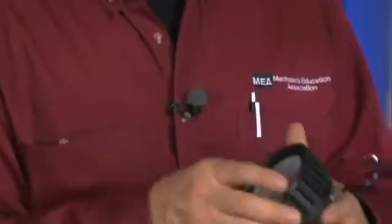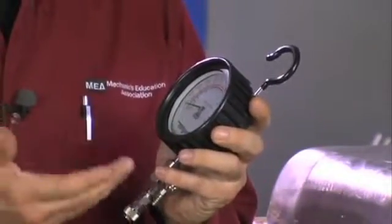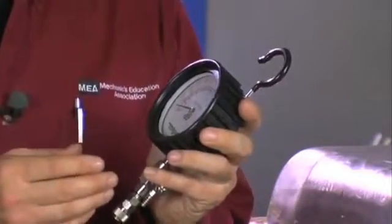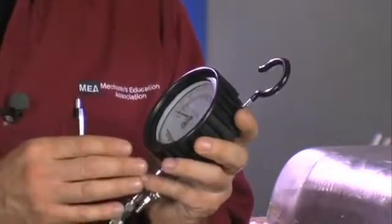We're going to need tools in order to check the pressure, to check the volume, and of course check the electrical integrity of the entire fuel pump circuit. So specialty tools are in order and obviously ensure proper diagnostics and repairs. So these are some other recommended items that we need to do after a fuel pump replacement to ensure the car doesn't come back with any drivability issues.